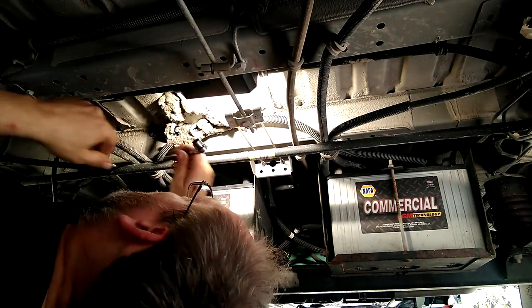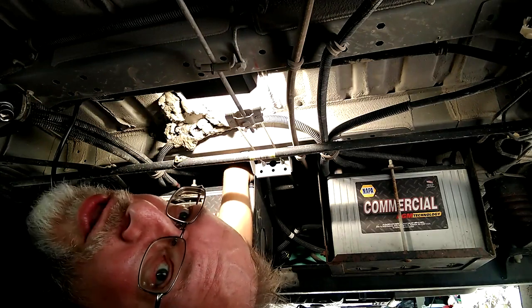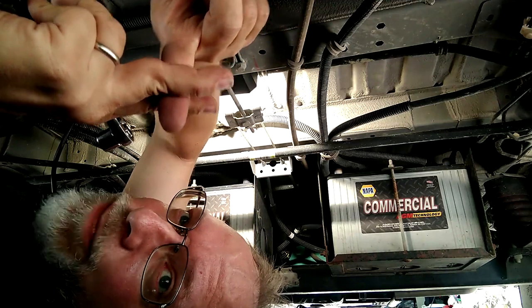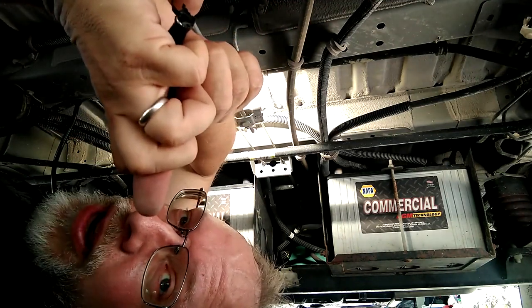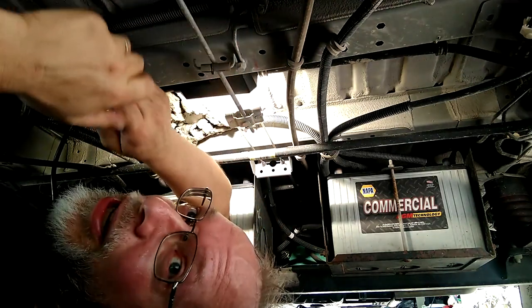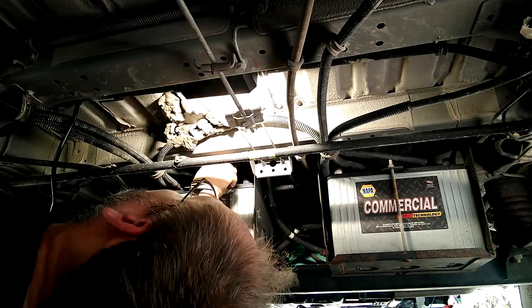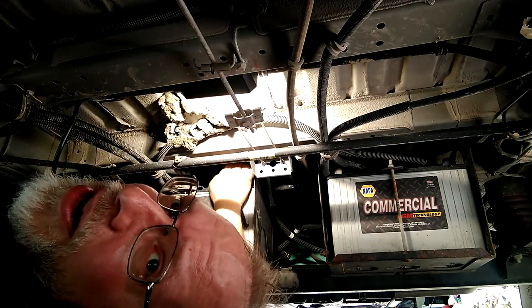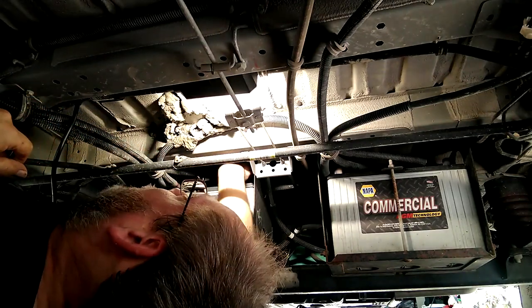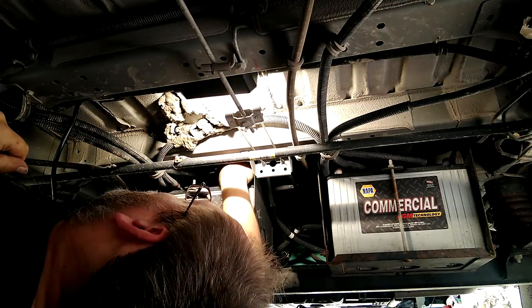I'm going to start by feeling up in here. On the right side of this battery I'm feeling a nut and a cable coming up to it. This one only has one connection because it crosses over to the other battery, which will have probably three since they put the solar on that right side battery as well. I'm going to take my half-inch wrench and get it on that nut. The cable at the terminal is bolted down by the nut — if the cable is bent up over the nut you might not be able to get your wrench on and you have to push the cable back down out of your way. The ground battery is ground to the chassis, so there's no potential difference — no sparks starting on the ground.